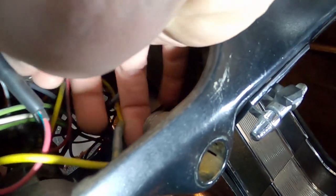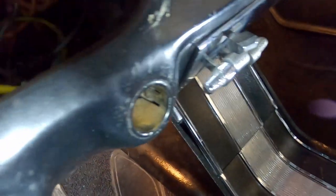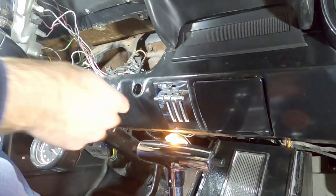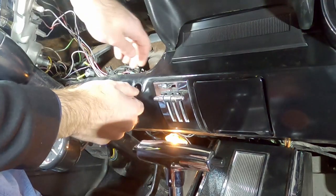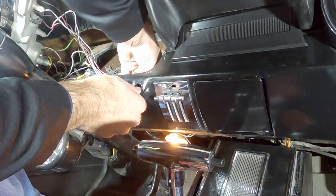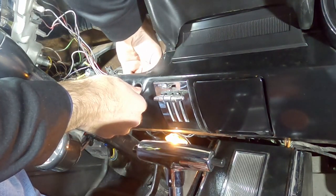What we're going after is this piece right here, and there's one wire on the back. We're just going to go ahead and unplug this wire — it just pulls off the back. This is what the connector looks like when unplugged. Now this thing is disconnected from the car. This wire in my car is a blue wire — it might be the same color in your car. The secret to doing this is to put your thumb in here to hold the inside piece and reach back behind and just unscrew the housing on the back.